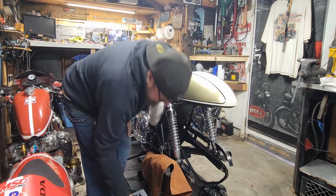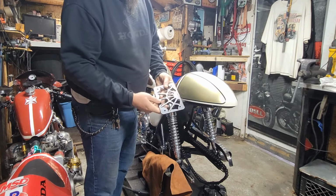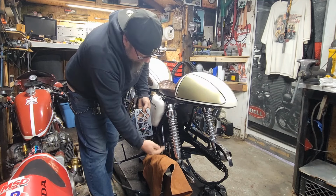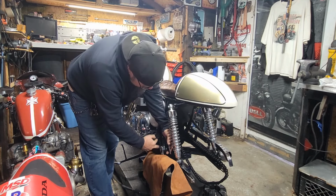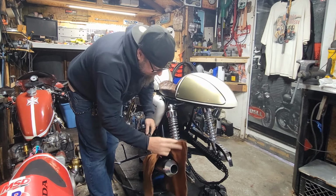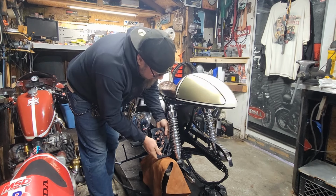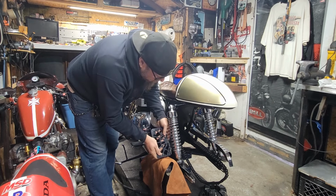Oh, yeah. So there's our plate mount. I done hacked it apart. I want it to go like that. As you guys can see, I ground a bevel in right there. I got the original part of the bracket bolted on here. And this is going to get lined up just about like that. Our muffler is right here, so I want to be above the muffler. Basically where I started my bevel, that's where we're going to start the weld.